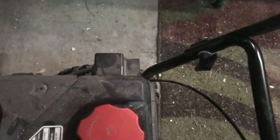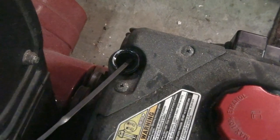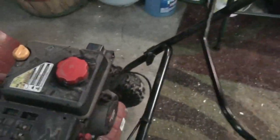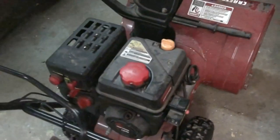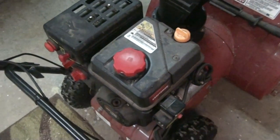So that bad gas is the first thing that goes. I checked the oil — the dipstick shows it's overfilled, and it smells like gas. Apparently he tried to start it too many times without it running and somehow got gas into the oil. Anyway, the oil is getting changed — that's going to be the first thing.